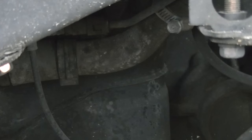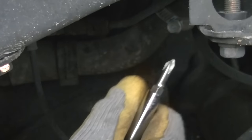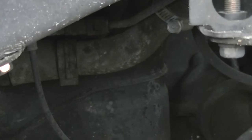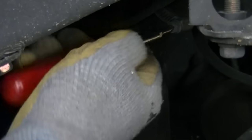The view you're seeing is through the wheel well of the wheel that we removed. Before moving forward, we need to remove three different hoses from the tank. The first is the lower fuel filler hose — this hose goes up to the filler neck and filler cap where you put gas in. Then you have the evap hose, which I'll show you in a bit, and also the vent pipe quick connector which goes into the fuel pump itself. I'm going to start with the filler hose — it's just a simple hose clamp that you can loosen and then remove the hose off of the filler pipe.